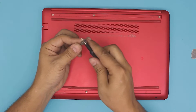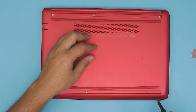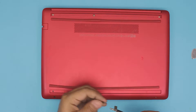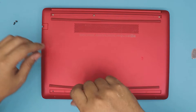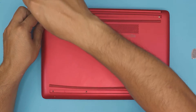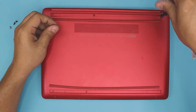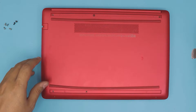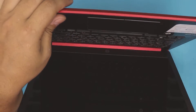I use a magnet with my screwdriver tips because I don't want to magnetize them, but this way it's easy to lift up the screws. Remove the two screws in the front of the laptop — these are colored black — then remove the screw that is under the bottom leg right there, and then the three screws at the back side of the laptop. They're all the same size so don't worry about mismatching them.